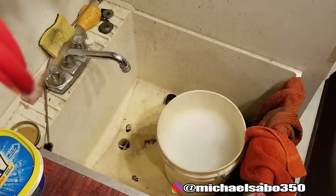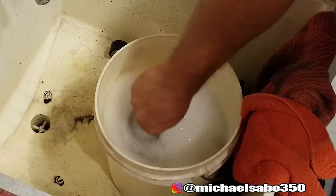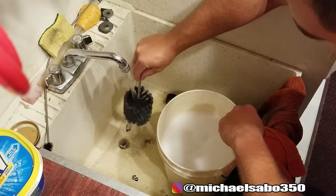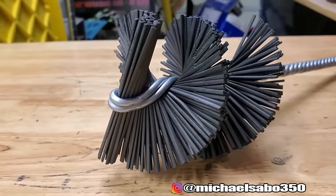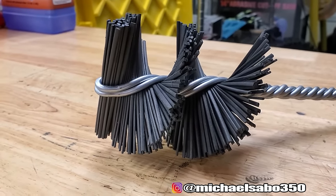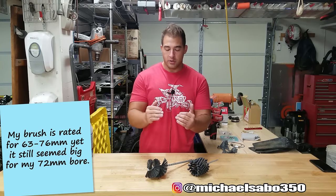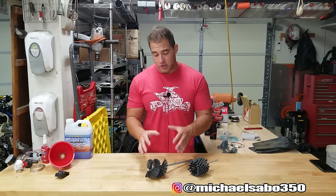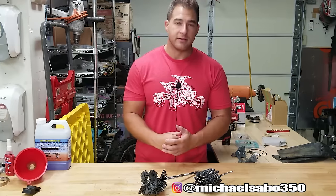For cleaning the hones, I couldn't find much information online, so I used mild dish soap, dunked them in the bucket, and rinsed — that seemed to clean them pretty nicely. You want to get most of the debris off before using them on your next cylinder. The flex hone worked amazingly. The brush hone I can't exactly recommend — I think in reality it was just a little too big for my cylinder. Wiseco has these in such a broad range it seems my cylinder was on the small end of what the brush can handle.